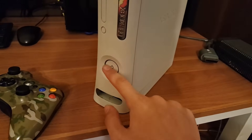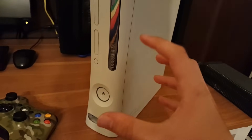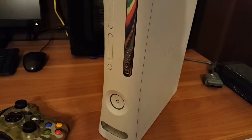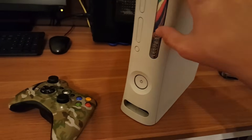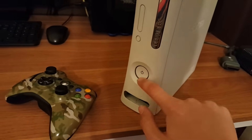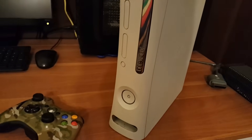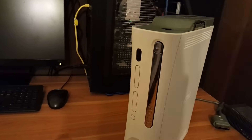Also, the red ring of death does not happen during gameplay. The three red lights is not something that can happen during gameplay — your Xbox will freeze, it will glitch, requiring you to turn off the system, and then once you turn it back on, that's when you would see the red ring of death. Also, the one red light is not at the top — it's down at the bottom corner, regardless of which orientation your console is in. That person said it means your DVD drive or hard drive has gone bad, and that is false — yes, that can happen, but for the most part that's not what it means.